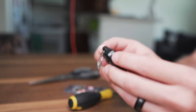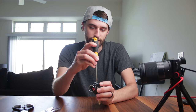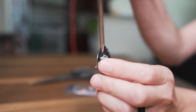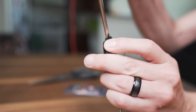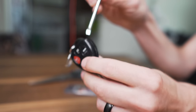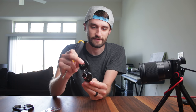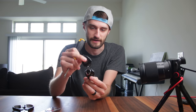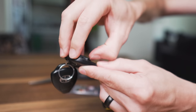Let's get right into this Toyota key. If you look at the very top of the key by the key ring, you're going to notice a really small slit. What you want to do is take a small flathead screwdriver, put that in there and twist, and you'll see it pop open. You can just go around the outside like that and pop the back cover off. You don't have to take the key ring off — just leave that on there. Then take out this little plastic module.